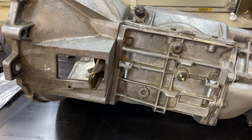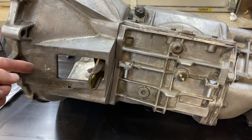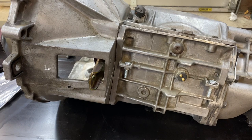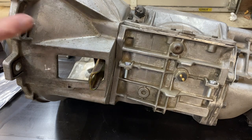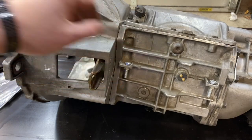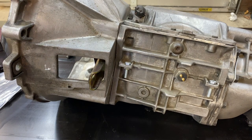The next solution would be to use an aftermarket bell housing like the ones made by QuickTime. They are set up to accept either style clutch fork, so you can actuate it going backwards using a Z-bar, or actuate it with a back-to-front setup like the OEM T5 bell housing. The problem with a QuickTime unit is they are extremely expensive — you're looking at $600 plus. A much more affordable option is to use a T5-specific bell housing out of a Fox Body Mustang. It bolts right up to the transmission with the typical small block Ford bolt pattern on the other end, and your transmission can be slipped into just about any classic Ford. But now we're back to the original problem: how do we actuate the clutch?